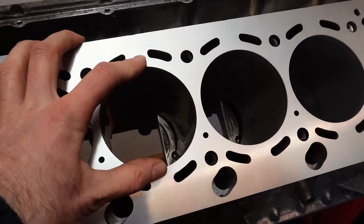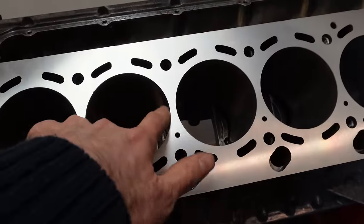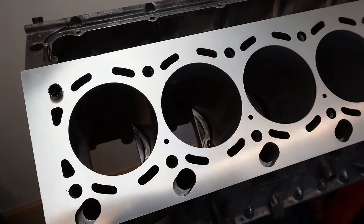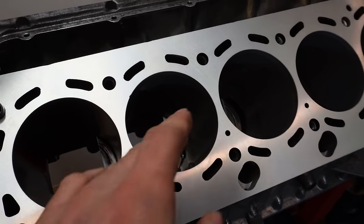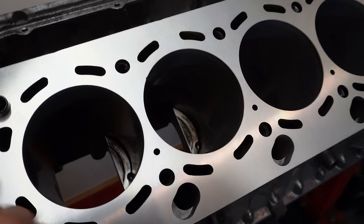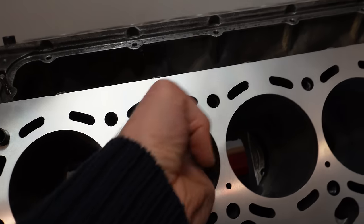So we're not changing the ovality of any of these bores, and we're not going to be changing the inner dimensions, anything beyond an absolutely microscopic level. The idea, as I mentioned, is to wear down this aluminium wall ever so slightly, get those crystals exposed, and the first step of that is to use Scotch-Brite.